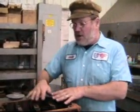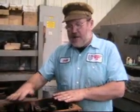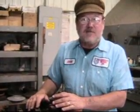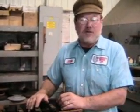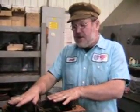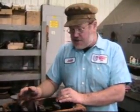And all the oil is being used here in the bearings. Now some people say, oh, my oil pressure is bad because my cam bearings are bad. That's not the truth. My oil pressure is bad because my rockers are weeping too much oil. No way. No way. The oil that's getting used is going through the bearings, and just generally speaking, it's going through the rod bearings, and that's where the greatest loss is.